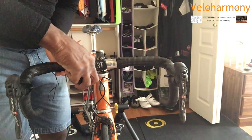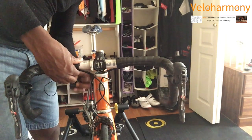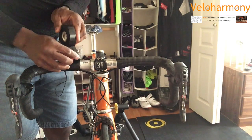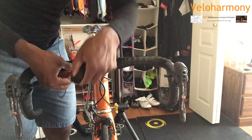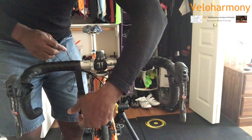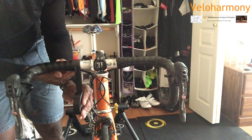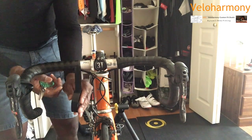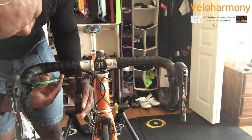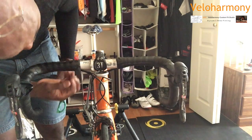And I just keep it on the tape. I'm pulling it. I'm gonna go down 2 times. Still being pulled. And once I come back around, I'm not pulling it anymore. I'm just laying it down, and then I'm gonna stop here. This is why I don't cut it early. I stop right there, and I'm only gonna cut enough of it to where the tape will end up underneath here. I'm gonna let it hang for a while so the vinyl can draw back in. I'm gonna cut maybe about, I'd say an inch. That's an inch, because I want the tape to be under here.